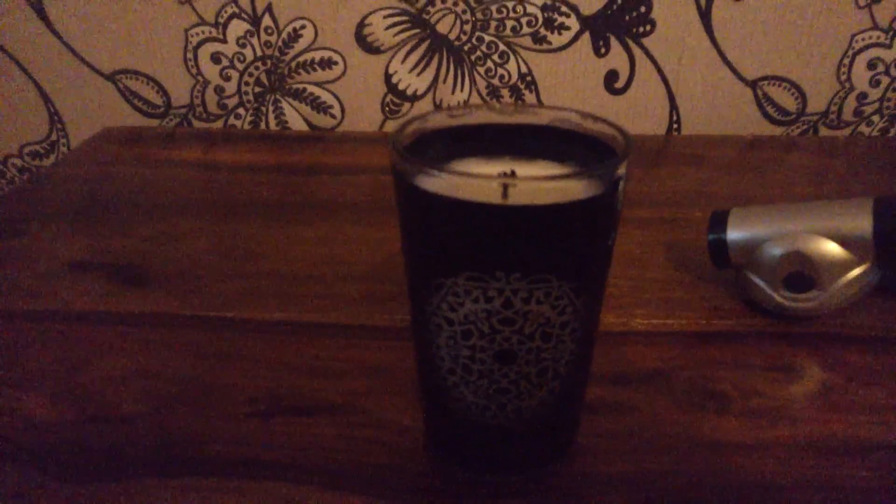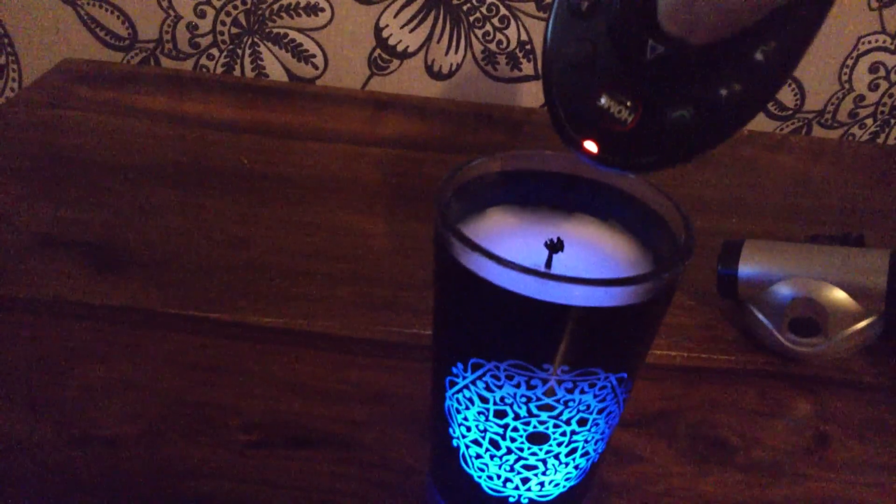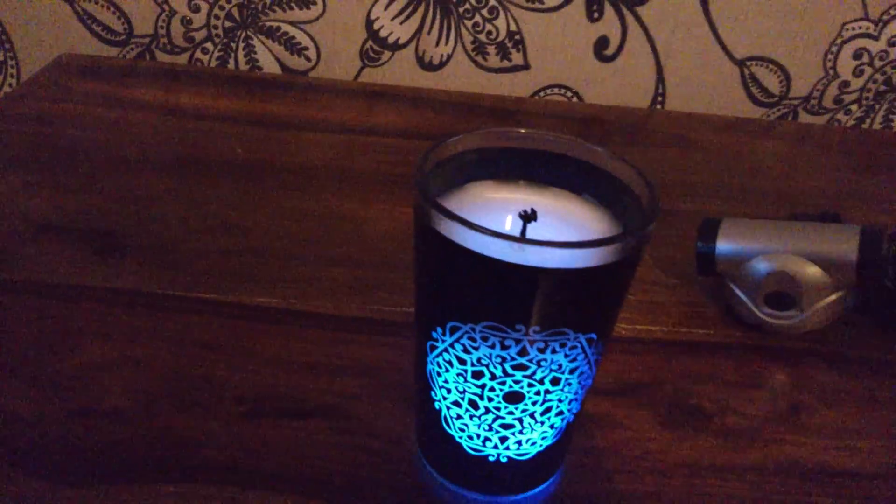You may have tried shining a light on it but it doesn't activate it. And it's not a heat thing. What it actually is, is it's an infrared sensor, a bit like the sensors that you get for alarm systems. So if I just get a remote control here and just push the button, you see, it activates it there.